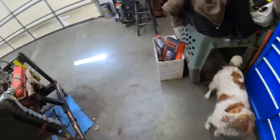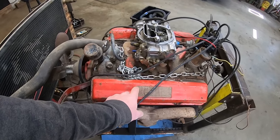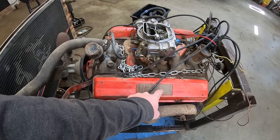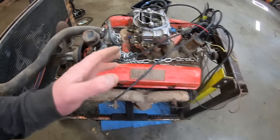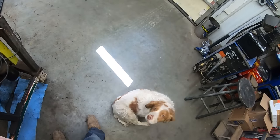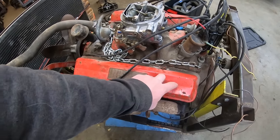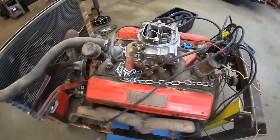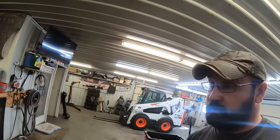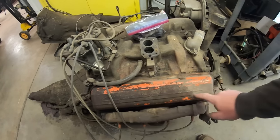Oh yeah, I'll tell them, Duff. Somebody pointed this out in another video that the 327 has this big square spot here, rectangular. My bad, I've always sucked at shapes. I like them round, right, Duff? You don't like my dad jokes either. And then they have this valley right here, this dimple from side to side and that rectangle. And then the 283s are pretty much just flat and have the script on them, with these two ribs here and then the Chevrolet script.